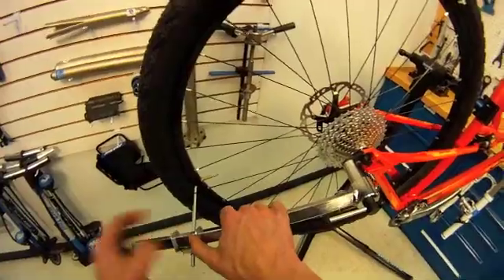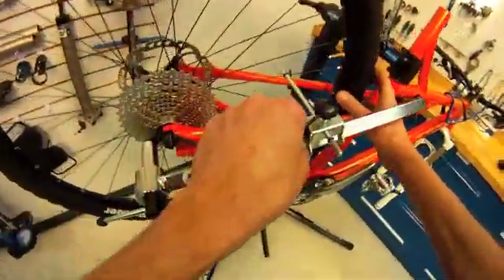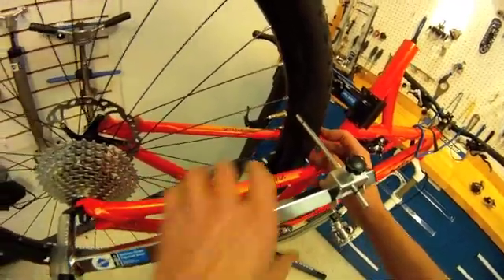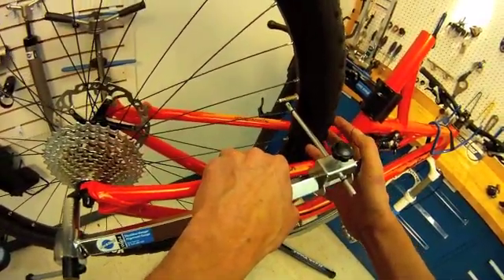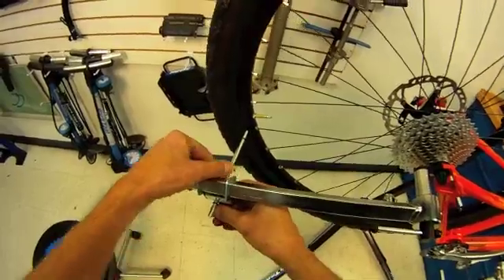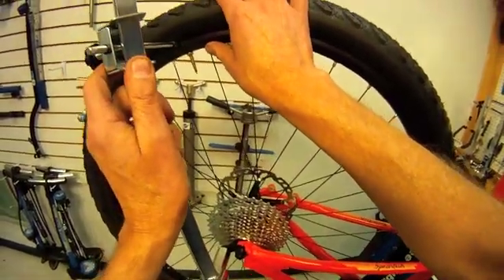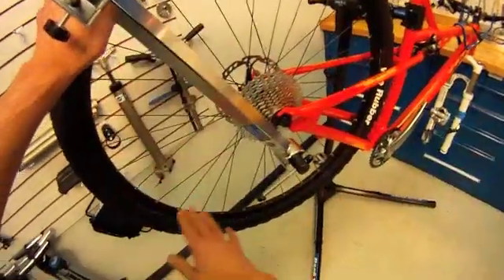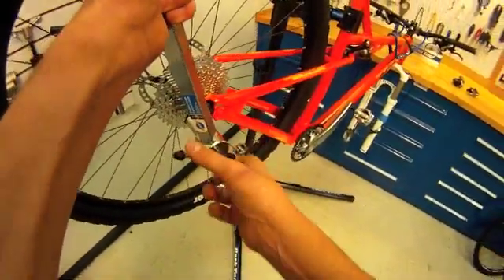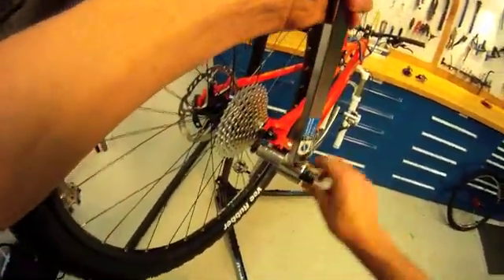Right over to the valve. Slide in here a little bit and go 180 degrees, and we can see we have a very slight gap here. I think we will do a little correction — we're going to bend just slightly. And we're going to go back and check. Yes, we were a little bit off. So some correction here is a good idea before we even get out on the road. That looks pretty good. We're going to go up to a third point here. So we have three points set off at 90 degrees — we know the fourth point must also be good, three points defining a flat plane. So the hanger was a little bit off, but now we're spot on, and that's going to ensure better shifting with our 10-speed system.